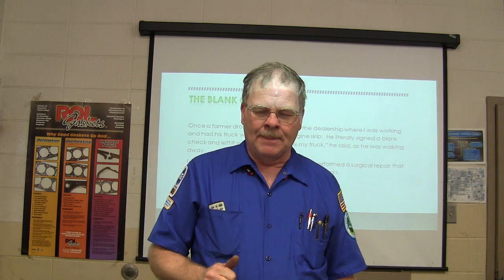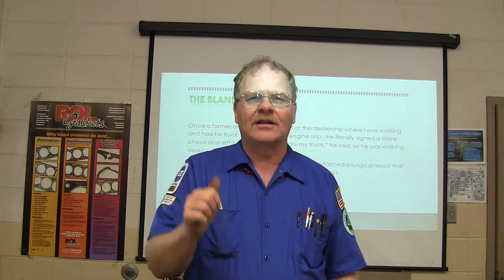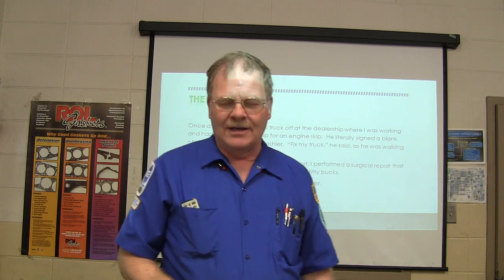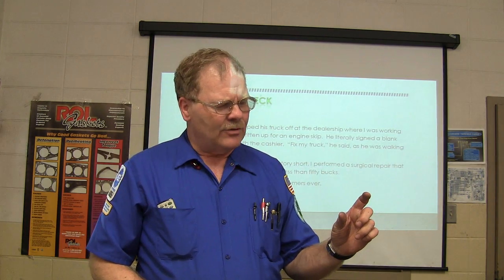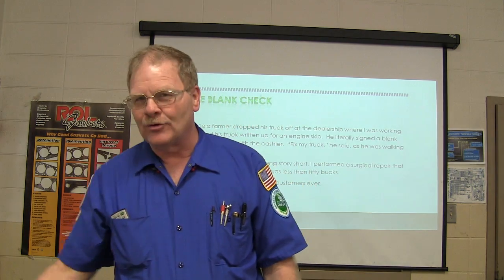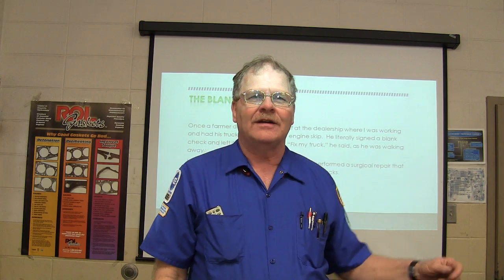I revved it up, and when I revved it up, I heard it dropping a cylinder. And so I fooled with the plug wires until I found out it was dropping number 3, and I took that spark plug out. It was a brand new spark plug. They had that tune-up franchise's name on it. And I dropped it in my toolbox, and I got an old rusty spark plug that would fit, and I screwed it in there, and it went boom, boom, boom. All it was was a bad spark plug.